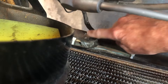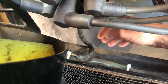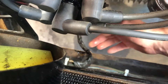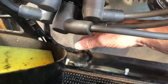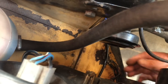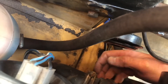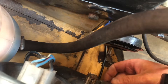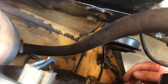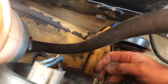There's evidence it's been collecting on the tray. The expansion bottle is at the correct level. It's been a couple of days since I drove the car - maybe it's tracking down that wire, but from where I don't know. It's probably very difficult to see but feeling around the hoses, it's wet on the bottom of this one here. I did have this off when I drained the radiator, so obviously it can be running down there and finding the low point. I'm just going to have a check of this and nip it up, although I think it's fairly tight - it could just be that the pipe's perished.